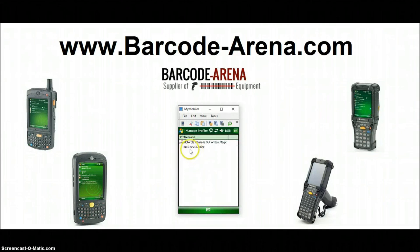Here's your list of profiles. This is a dummy default profile, and you must right-click and disable it. If it's not disabled and your device disconnects for a split second, it's going to move up and try to connect for 10 seconds. If you've ever noticed your device sitting there for 15 or 20 seconds reconnecting, it's because this dummy profile needs to be disabled.